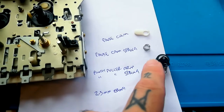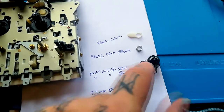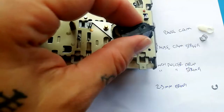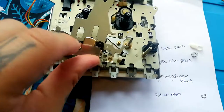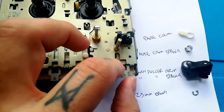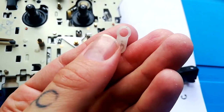Here are the parts relating to the pinch roller arm. First we remove a 2.5 millimeter e-ring, and the pinch roller arm itself has the pinch roller spring attached — it's dangling from a hole there. That slots on like that, and the other end is on this hook here, assuming the plate was still on it. Underneath that we have the pause cam spring, and here's the pause cam. The latching movement of the spring depends on how this little pin on the pause lever interacts with this hole on the base of this piece of plastic.